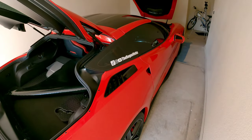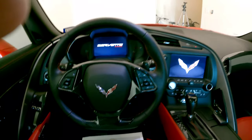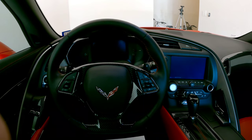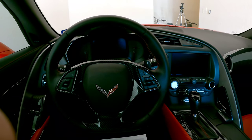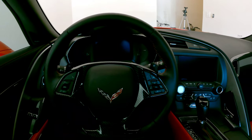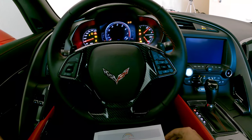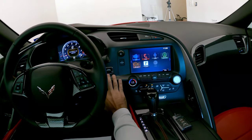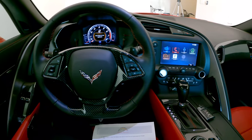Alright guys, go ahead and reconnect the battery terminal and then we'll start the car. The throttle body is installed. The instructions say to turn the ignition on and let the engine idle for three minutes, then turn the ignition off for one minute, then repeat — let engine idle for three minutes, then ignition off for one minute one more time. After that there's a drive cycle step where you go up to about 44 miles per hour and come off the throttle. Let's turn it on, let it run for three minutes, then we'll cut it and repeat the steps.